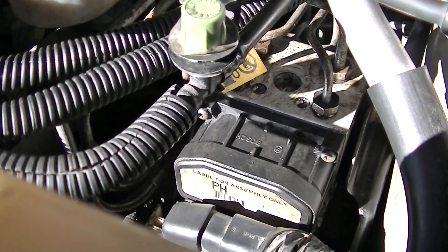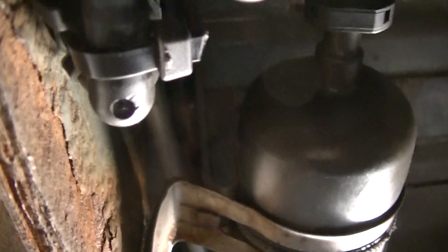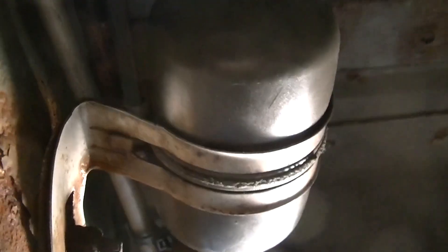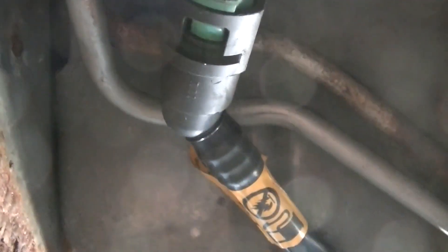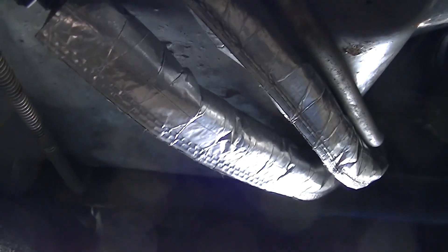Let's look under the car. Here are the plastic lines that go to the fuel tank, and here is the fuel filter. Here's the colossally hard-to-get-back-together fuel line — I did put some cable ties on it because it didn't feel like it snapped in very tight. There's the big fuel supply line that goes into the fuel filter, so that flows to the engine. You've got those spiffy little foil blanket things that protect it.